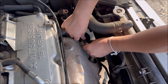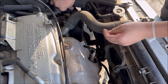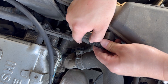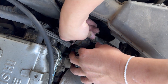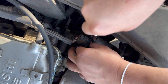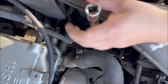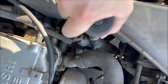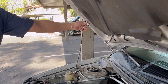With the click of the torque wrench, let's move to the next step. First, clip this wire back onto the heat protector. Next, fish the wire under the radiator hose, then clip the new harness back into place. I did find the bolt I dropped earlier — I'm going to hand-tighten it until it's snug. I couldn't find the torque spec for connecting this bracket to the thermostat case assembly, so I'm tightening it with the ratchet until it's nice and snug, but not so much that it damages the thermostat case assembly. And that's it for the repair.